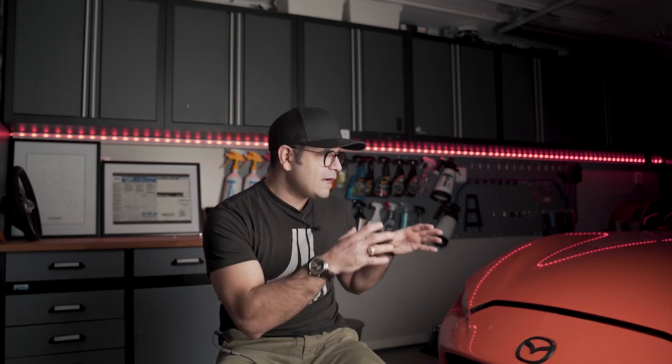We will also see that in the video, what I'm talking about. And I need to mention that I have Pilot Sport Cup 2 tires, 215/45 square all around. For the wheels I have Koenig Hypergram with the machined lip, so they are gray with the machined lip, and 17x8 square as well. The ET, I think, is 45 all around. So that is that with regards to the setup that we have on the car.